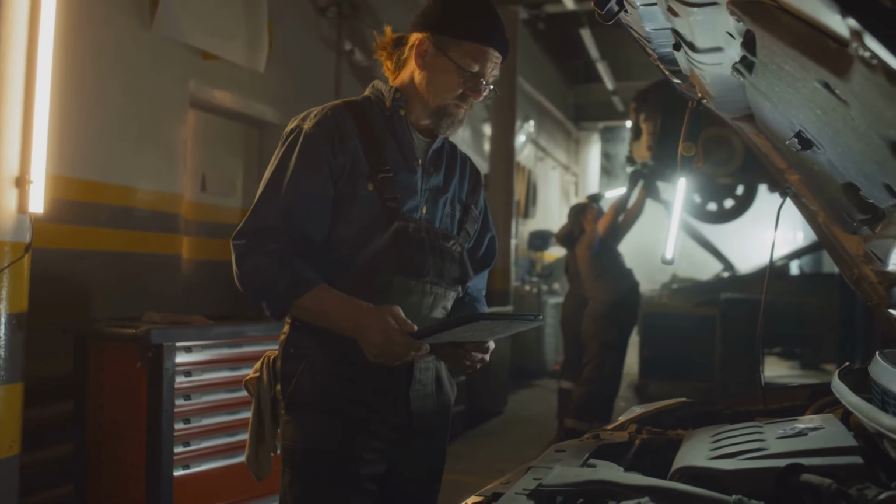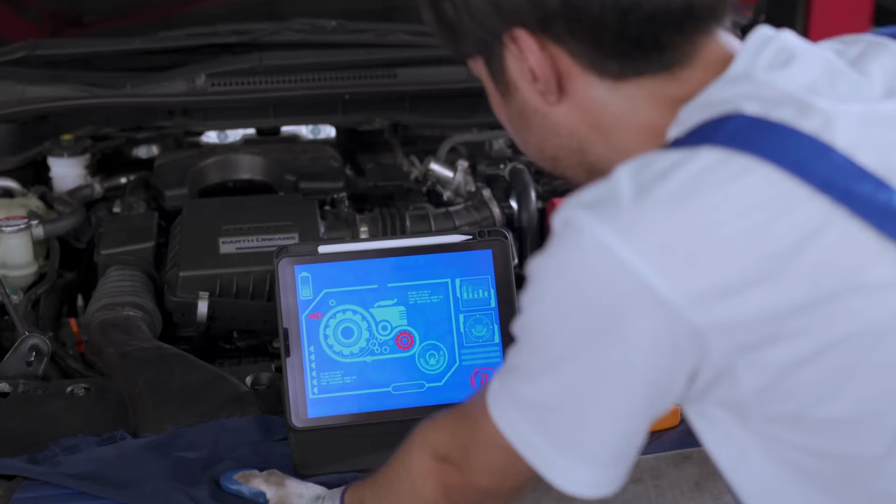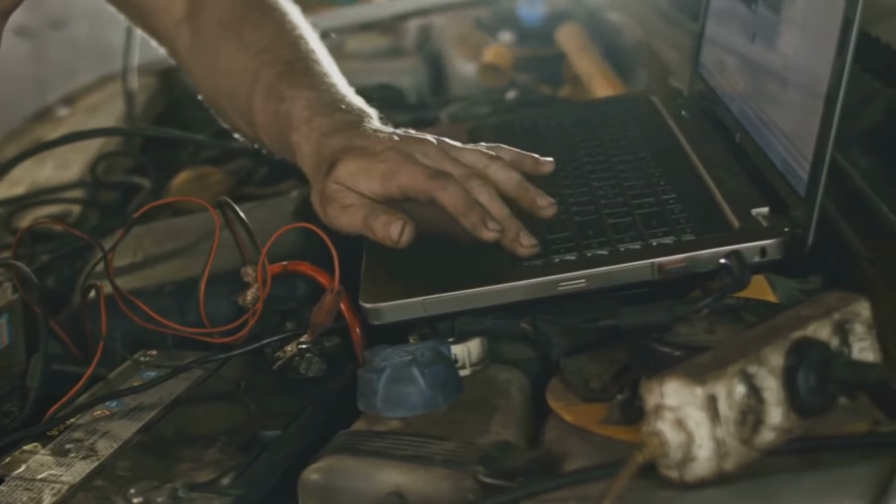First, check compatibility. Make sure the scanner works with your car's protocol. Live data is a must-have. It lets you see sensor info in real time and confirm repairs. IM readiness is key if you need to pass emissions. It shows if your car's systems are ready for testing. User interface matters. Some scanners are handheld, others are Bluetooth dongles that work with your phone. App-based scanners often offer repair reports, code lookups, and cost estimates. For example, BlueDriver gives detailed reports right on your phone. Decide if you want a rugged handheld or a compact dongle for your smartphone. Choose features that match how you'll use it.